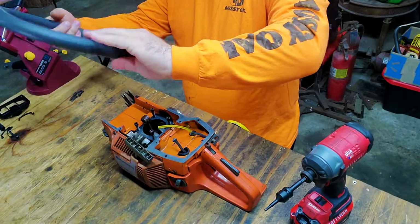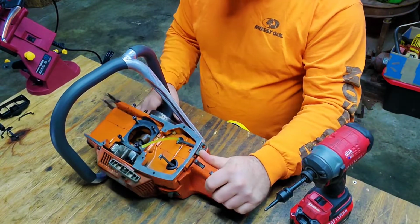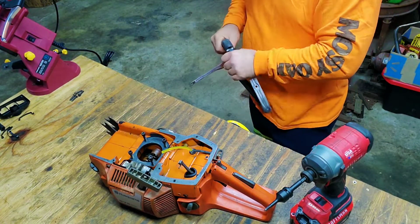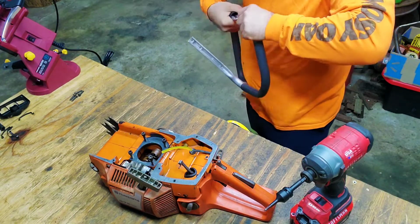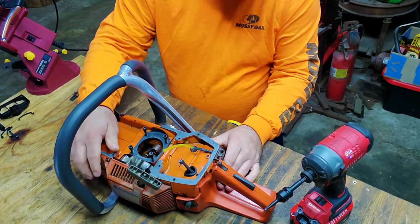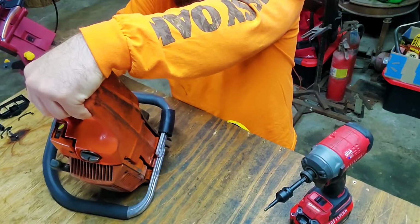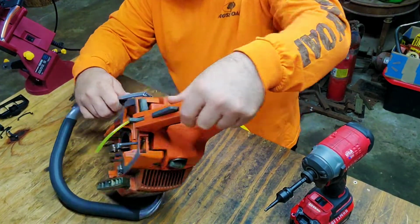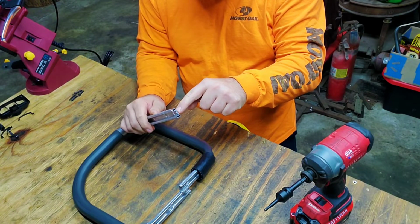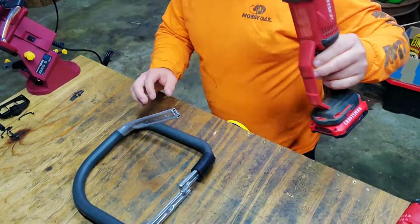Okay, what we need to do is just start by just sitting it on there and see what it looks like. That's what the guy did first. Might have to move this big rubber piece up a little tiny bit, because I need to know if it's going to bolt up to there. OEM holes. They're spot on. Only difference is this square piece right here, I'm going to have to cut at an angle a little tiny bit. So let's get this started.